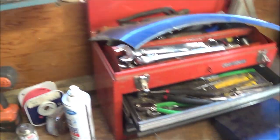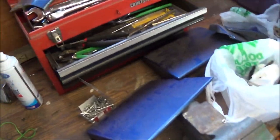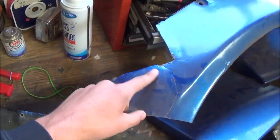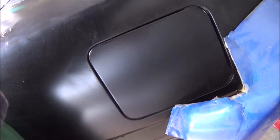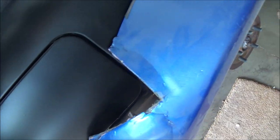For the other flare, since I don't know where the pieces are for the other front flare right now, I'm going to take this back flare and we need to patch this as well, but we also need to make the insert for the gas cap. It goes right in here - that's where it goes - and I need to make those inserts so you're not seeing straight through the body and water's not being kicked up through there. It looks a little messy because it came apart all disgusting when I took it apart, so it's going to need some patchwork, but it should just be tedious work - just sanding and stuff like that.